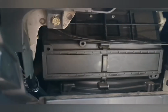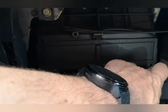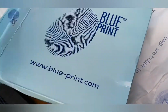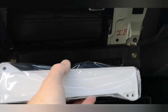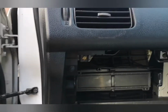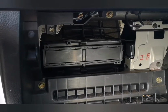Anyway, so what I've found on videos, a lot of the US market ones, they've already had an air filter put in these two points there. It's normally got a blank plate for the back of it, and it's screwed into those two holes. So this is what the cabin filter looks like. As you can see, those holes line up, like I say, for when it goes on, in the same place on there. But because you don't have access, what I've found out is with the UK ones, or a Japanese import like this car is, if it hasn't been changed, you've got to cut that round, that line, and cut that out. So let's go for it.